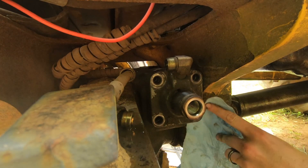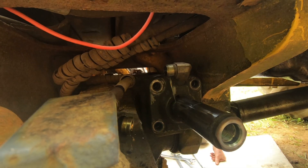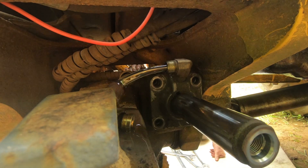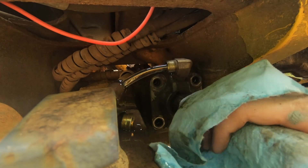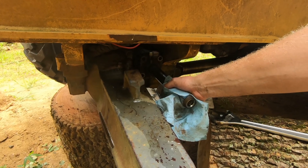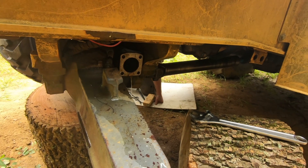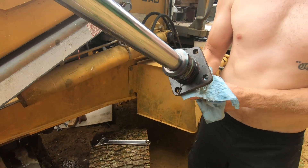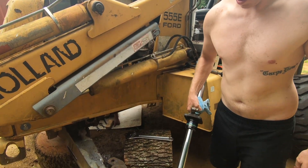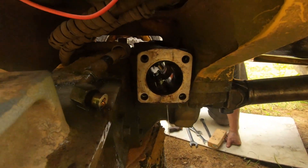It's unseated and it's draining all the hydraulic oil out of the cylinder. So don't be like us — use a bucket to catch the oil as it pours out. You want to push the cylinder back through and out of the left side. All the seals on the left-hand side of the machine are built into the end cap, so we can rebuild those on the bench.